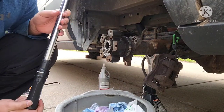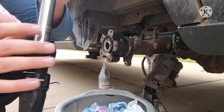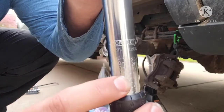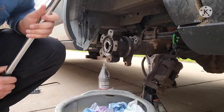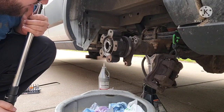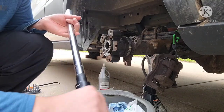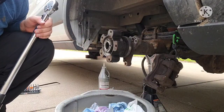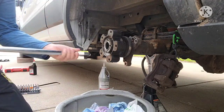One little quick tip, I had to go run to O'Reilly's and rent their torque wrench, because I don't know if you can see. See how that says torque left or right? My torque wrench only torques righty-tighty. So if you're gonna need to do this, you gotta make sure your torque wrench has a spec and it'll click going left, because these are lefty-tighty screws, left-hand threads. So without further ado,